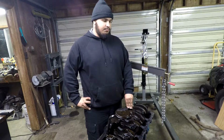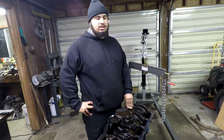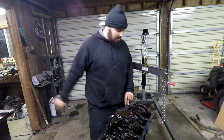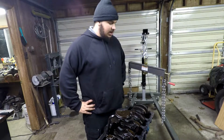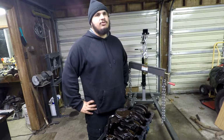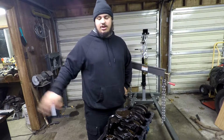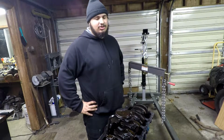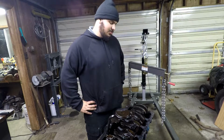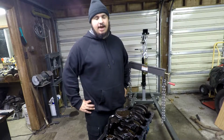It's going to take a butt ton of brake clean, because brake clean is the best thing in the world when it comes to doing this stuff. It's the fastest. You just take it off. While I was at the diesel shop, we actually used a pressure washer, but that kind of sucked, because immediately after you were done pressure washing all the oil off, you got a thin layer of surface rust, which wouldn't have done anything. It was just ugly. So we had to go in with some oil rags and oil everything up just to keep that from happening after we clean them off.